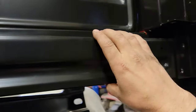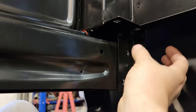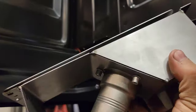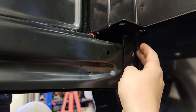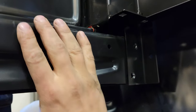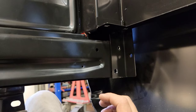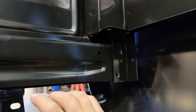While I'm under the truck, I'm going to follow this rear cross member into the corner here. This material needs to get removed so you're able to slide this assembly up underneath this pocket in behind where the taillight goes. I'm going to pre-mark this. I have the ability to remove this cross member — you might not be able to, but the steps are very similar. Let's go ahead and mark everything and then pull this cross member out and start cutting.